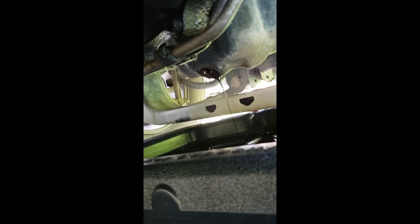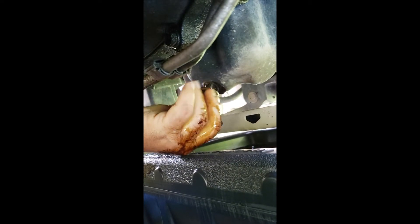It's a little warm because we went to church this morning, but a warm oil drain is what you want because the viscosity is thinner and it'll drain quicker. Just sit here and relax and wait for it to drain. As you can see, it's relatively thinning out from the drain because all the oil was drained down to the bottom of the pan and thinned out from the heat of the engine.